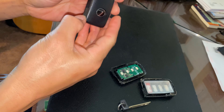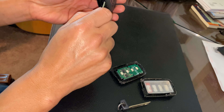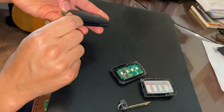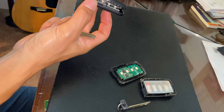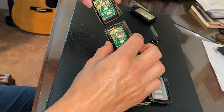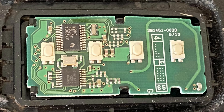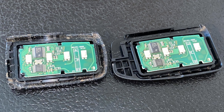Do the same with the Lexus key — put it in there and pop it right off. Now I bought this key on eBay, I'll post a link below. It was actually cheaper than the OEM Toyota one. It's a used virginized one. A lot of sellers online sell these between $85 to $100. In here you'll basically look for the part number 281-451-0020 — it's the same number on both keys. The other thing you want to look for is the little G on the lower corner of the board. Both keys have that G, meaning they share the same internal board.